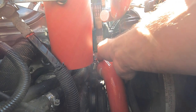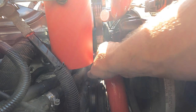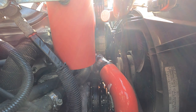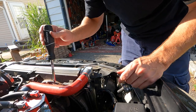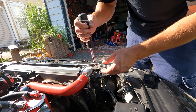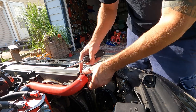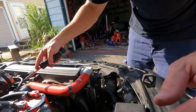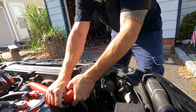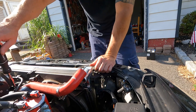Loosen this little hose clamp up and get this thing out and drained. There's not a lot in there, that's good. Being that this hose goes around the bottom up to the top, it's not leaking too much — should have most of it out of the radiator. I'm going to loosen this one up and pull it from the water pump side to give us room to get the fan out. Dry as well, good.